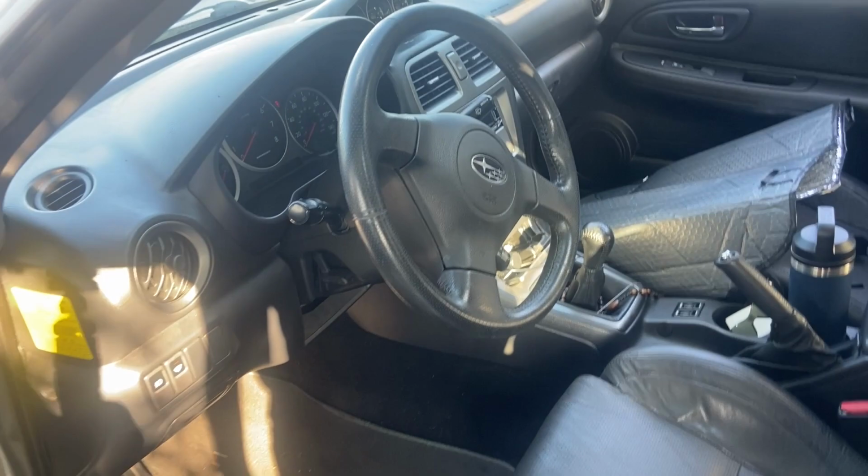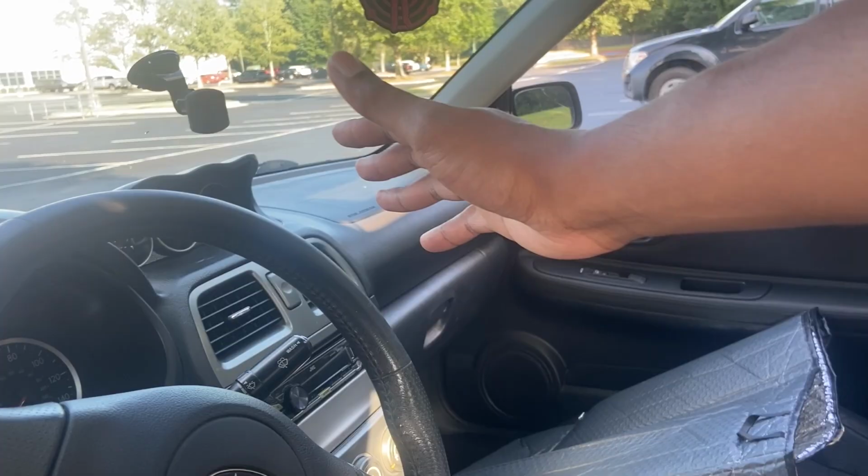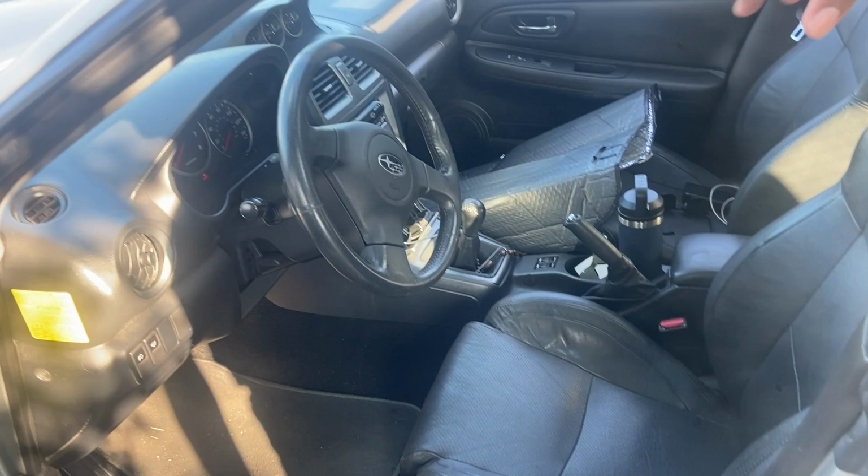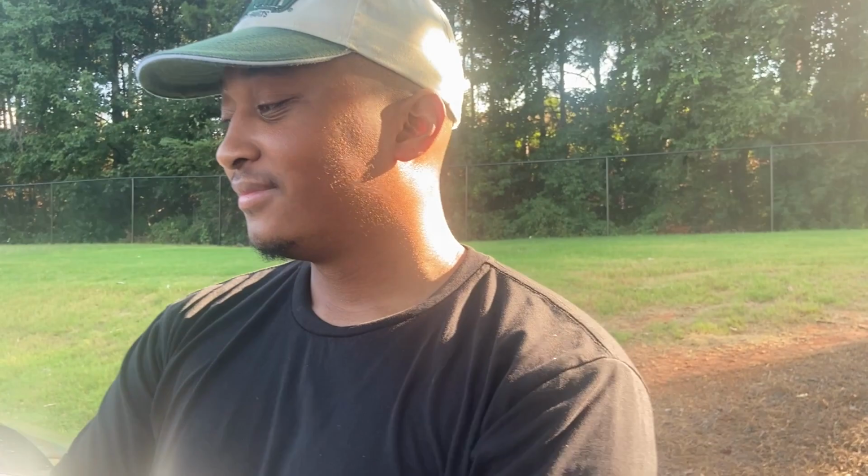Yeah, mainly stock, and then I have some old-ish gauge cluster I bought off eBay, Facebook. It's called Mad Dad Gauges, I think. It's oil pressure, boost and exhaust. But I don't have the oil temp connected or the exhaust temp because you have to weld a bung to your exhaust wherever you want to put it. So I haven't done that yet. I don't know if I will, but they look like the Blitz gauges from back in the day. I can show you how it comes on.